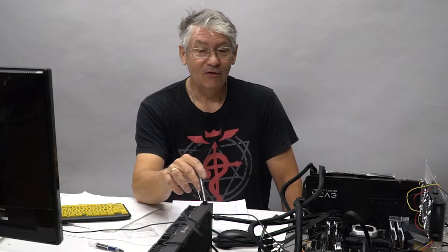Now, we haven't put in the 480 millimeter radiator, which is twice as thick as this and much longer. And we haven't run the really high-end EK water block either. We've got this kind of crappy water pump block. It's okay, but it's not like the high-end one. So, success, big time. We have a huge drop in our core temp using the same overclock settings, the same ambient room temperature, and the same cooler.